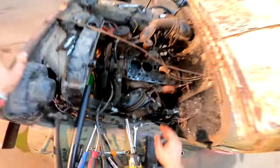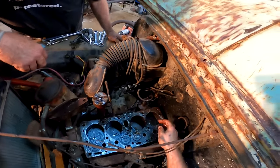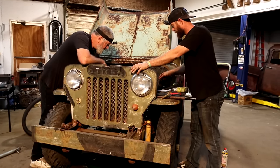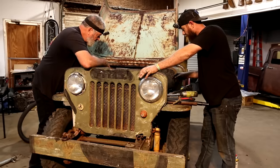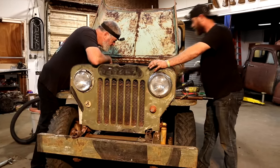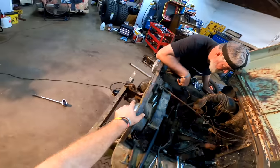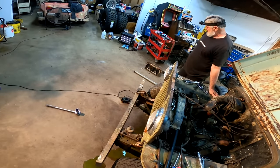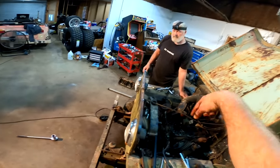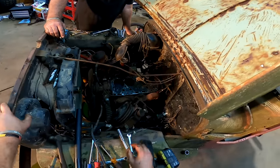It's only the top of the cylinders that go way down in there. It's the top inch and a half. It's still really rusted there. But down below that, it's not that bad. Right. You'd have thought the piston would have been up to that point right there. But I don't know if that'll clean off or not. But like I said, at least down in there and the rest of them, I think that's going to be our main problem. I think so. Rest of them ain't that bad. And that's the one that the intake valve is stuck open on. Right. So I bet you the hood was open, some water came through the carburetor area, maybe through that gasket area, or something, and filled that cylinder full of water there.